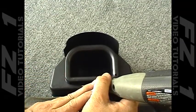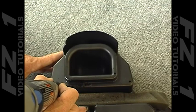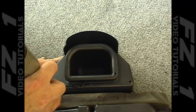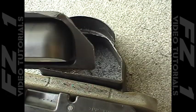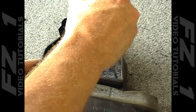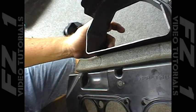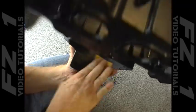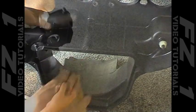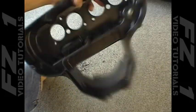After removing the air box, we're going to turn it over and begin cutting. For this, I'm going to use a Dremel tool with a rotozip bit to make the initial cut. It's best to keep the tool well inside of the edges while working your way around the perimeter of the flat portion just above the snorkel. Continue all the way around until you remove the piece you are cutting out. I left that lower portion at the front edge intact, but for maximum effect, you can go ahead and cut it off as well. Using the drum sander, the rough edges can be brought closer to a good finish. Keep working the edges until you have an even cut line all the way around. Begin sanding with 80 grit sandpaper to knock down the rough edges, then progress through 240 and 400 grit to get the surface smooth. Finally, the area can be wet sanded with 600 grit paper to get a really slick finish. With a little work, you can get the plastic surface back to looking like it did before.